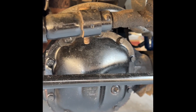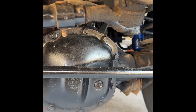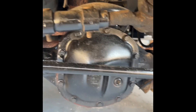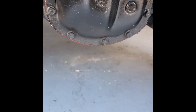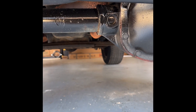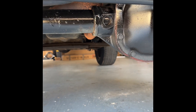That's what we're replacing today. And as far as the fuel pump goes — on this last update I put the new fuel pump in, it worked for about 20-30 miles, and then it started sputtering again. So I'm still trying to figure out what the problem is with that. I'll move on to fuel injectors, fuel rail, air cleaner, all that stuff. It's just gonna take some time and a little diagnosing.